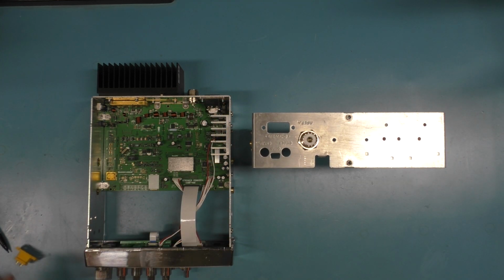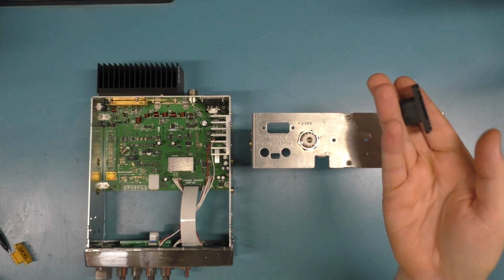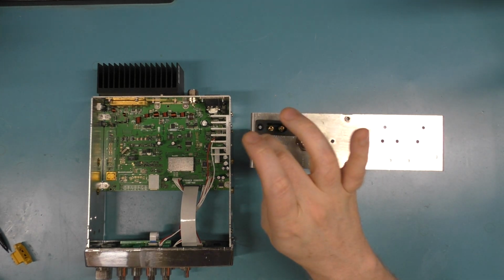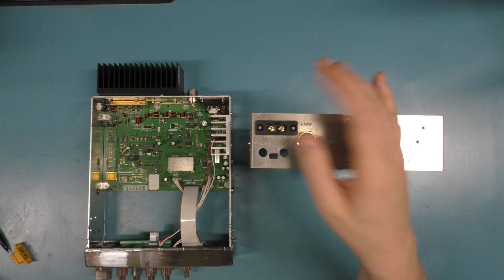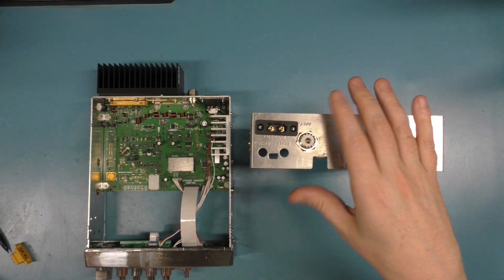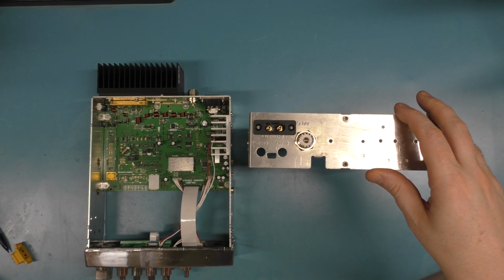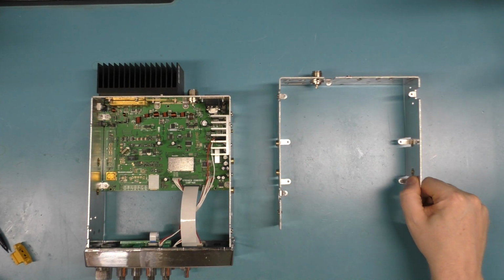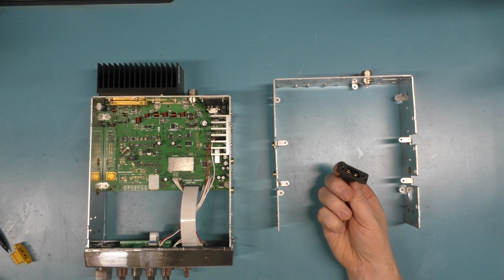Yeah, you could make it work. Or you could just get a 90, which is an even heavier connector. Not that you need it, but these just fit. The only thing you've got to do is oval these holes. Get a round file and file it down just slightly on each end, and now you've got it. Put your nut and your bolt through, put a washer on the other end, obviously, since you've got an oval hole, and I can't see that going anywhere, and it's neat. It fits in there okay. So that would be a direction that, if it were me and I was concerned about it, I would go that way. I would use one of these.